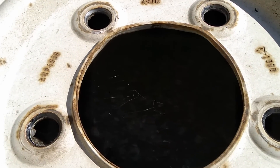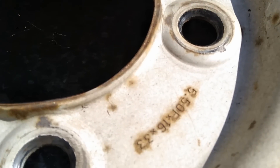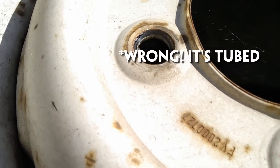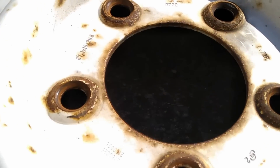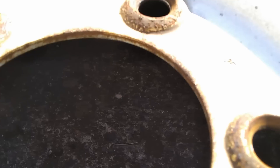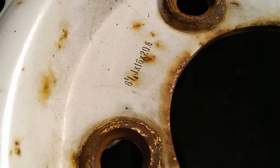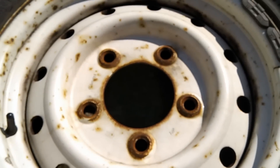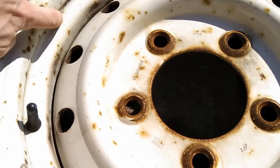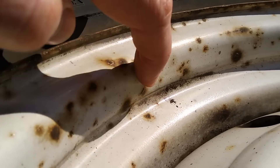Starting with the Land Rover standard rim - this is quite thinner than the Wolf as we'll see in a minute. These are some of the markings you get; this is a tubeless variety. They do tend to rust a fair amount. The Wolf rim is a lot thicker - you can see the metal is a lot thicker. These also rust naturally because they're steel. The difference between the tube and the tubeless is the ridge - here you can see a ridge just in there, that's the ridge for the bead of the tubeless tyre.